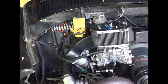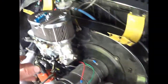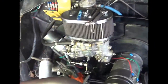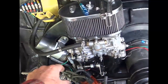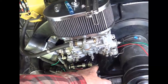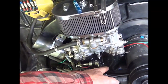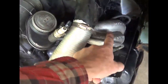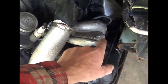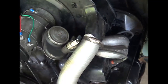What I'd like to do is see if I can get this center mount carb to work because I really like the space that it opens up here on the side. It's half as many spots for troubles. Now some of the manifolds I've seen have a separate tube for each side. This type of manifold and most of the ones I've looked at have a little connecting hole in the manifold. And of course we all know if we're working on these things that the intake manifolds have a slot that opens it up and equalizes it right where it attaches to the head.